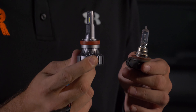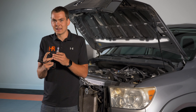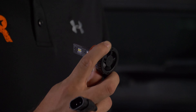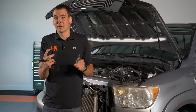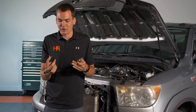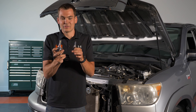This bulb in my right hand is the SV4 bulb, and the reason we chose this one is it actually fits between the low beam socket on the back of the headlight and that little sheet metal divider that is part of the chassis on this truck. If you go installing any old giant heat sink fan-based bulb back there, chances are it won't fit. It doesn't matter how bright the bulb is if it doesn't fit your truck. This bulb fits, and it is just unbelievably bright — the before and after is just silly.